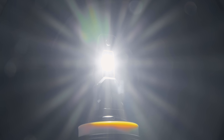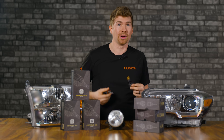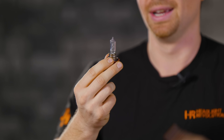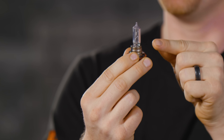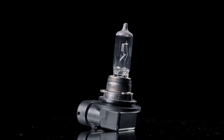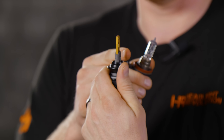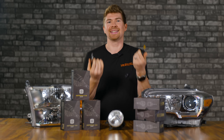What you're going to see on this wall is a different looking beam pattern and brightness. Don't just pay attention to brightness — pay attention to the difference in the beam pattern that is going to keep you safer when you're driving down the road. Essentially, what we're looking for is a bulb that can directly replicate the original halogen bulb. That bulb has a wire wound tungsten filament, and this part needs to be at a certain place inside the headlight housing so it doesn't scatter the light. So if you get a bulb that replicates that wire wound filament by having a small chip set on a small PCB, you have a recipe for a very good beam pattern.